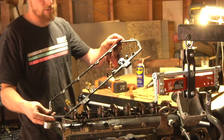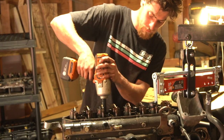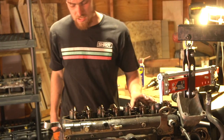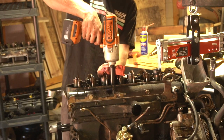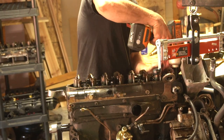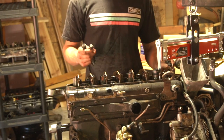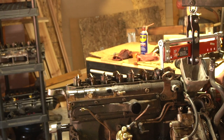They just slide off the top — that's your top wiring harness. You have to take the injectors out before you pull the heads off so you have bigger impact there. Now you have six bolts on the outside of the cylinder and then twelve on the inside. We can just take out all of these. I have it sitting upright so I can just pull all these head studs out. I'm going to take off this front pulley — I could have probably done this before.